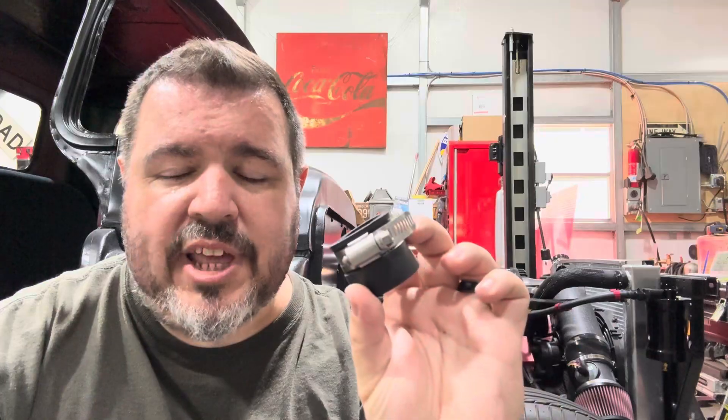I've taken the air element off the catch can — we're done with that. In its place we're going to be using something called a Fernco quick cap. If any of you guys have done plumbing before, this is basically a rubber pipe cap — sealed at the end, open at the bottom with a little hose clamp. The standpipe opening is one and three-eighths diameter, and this is a 1.38 opening Fernco. The part number is Fernco QC-1.38.